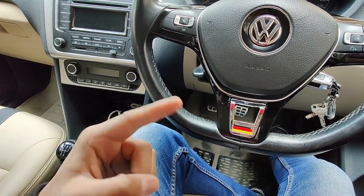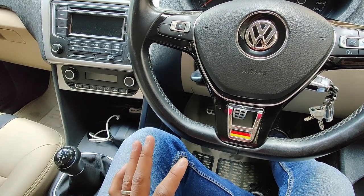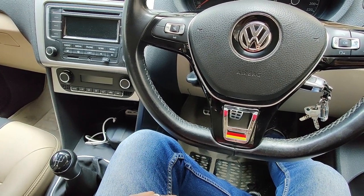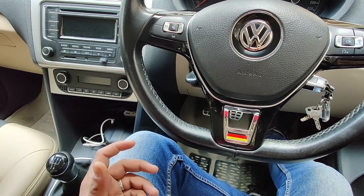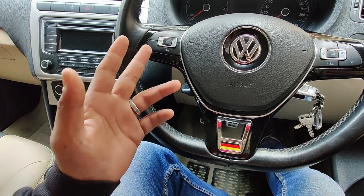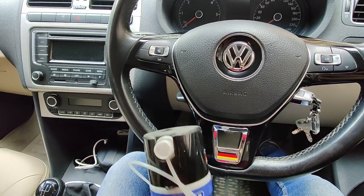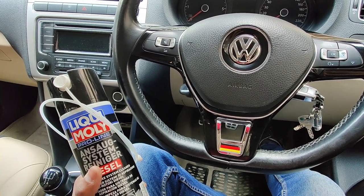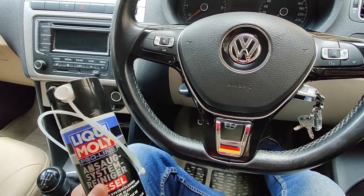We are not going to do it in the same manner. The car also needs to be at 2500 RPM consistently. I initially thought I'd need a friend to maintain the RPM, but then I realized I can simply put a brick on the accelerator pedal — our car has a soft rev lock at 2500 RPM — so I can do this alone. Always spray in short bursts of two to three seconds.